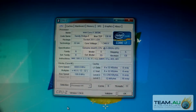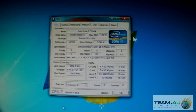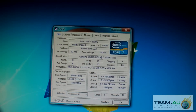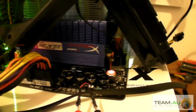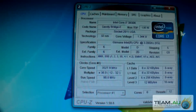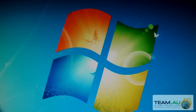The second interesting thing about the OC Touch buttons is that it's a hardware change, but it does not affect BIOS settings whatsoever. So whatever I do in Windows - like if you're pushing, say, 5.7 GHz and you're pushing for 5.8 and you crash - next time you reboot, the BIOS is not going to remember 5.8. It'll still stay at 5.7 or 5.5, whatever you're booting at. So basically I've dropped the CPU Multi by 4 so I should be at 3.6, and I've dropped the B-Clock to get 98 MHz B-Clock. We're going to have 36 Multi on the CPU - so 3.53 GHz.